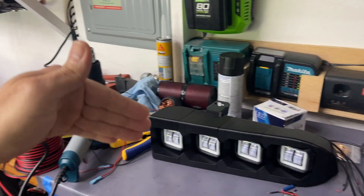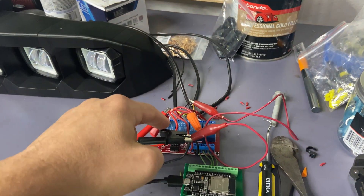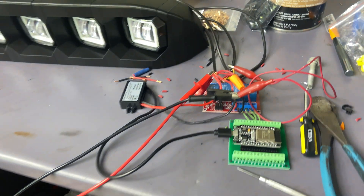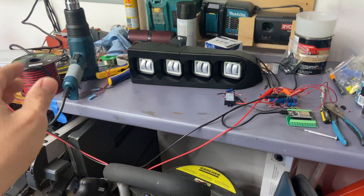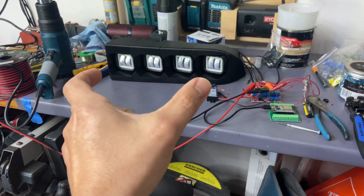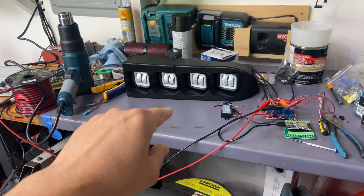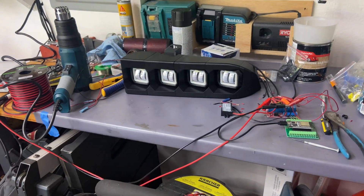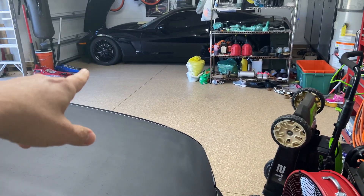My Corvette has a startup sequence with that little triangle shape — a little startup sequence that comes on when you start the car — and I thought that was really cool. So I got a little ESP board, a couple relay sets, a power source, and I've got something wired up. Now I'm trying to work on sequences and how the halos light up when you start the car, because I've got it wired up so the halos get power when you start the car. I put a little fuse tap in the fuse box.